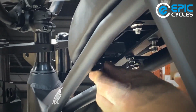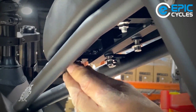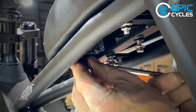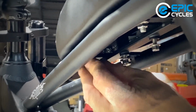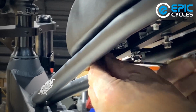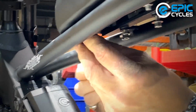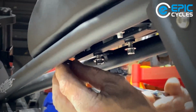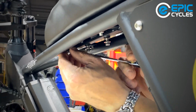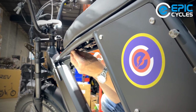All right. You might find that using a socket wrench might be easier. But let's say you don't. This is pretty much how you're going to struggle with it. And you're just going to go through all 6 of these bolts and snug them down. Now, it is on a plastic housing. So these bolts, they're going to feel some resistance. And you can keep tightening them until you pull the bolts right out of the plastic seat if you're not careful.